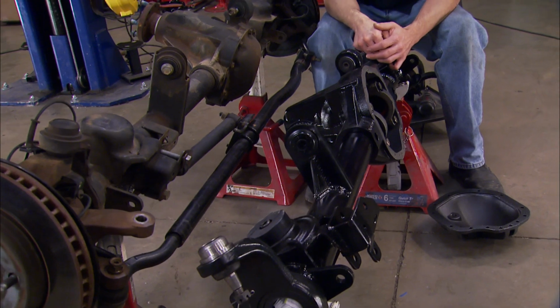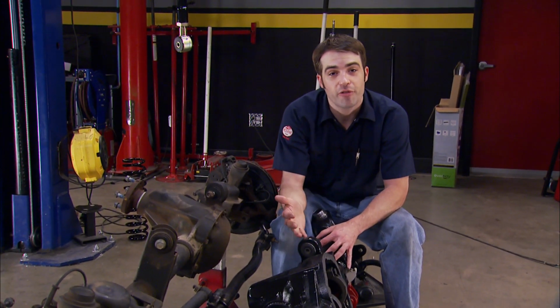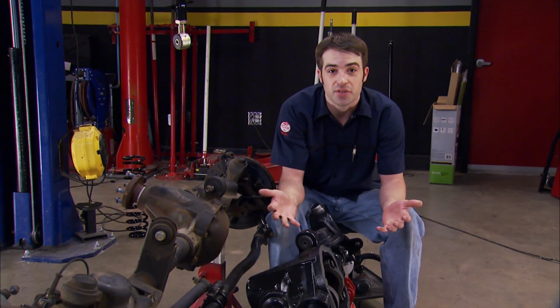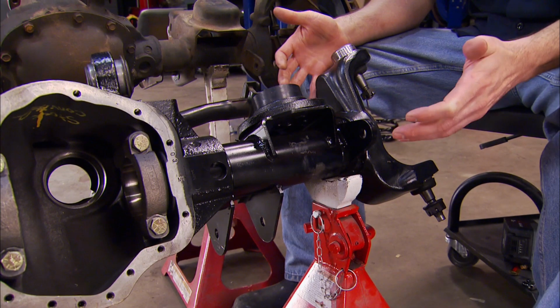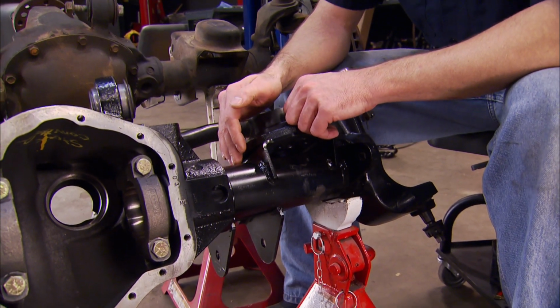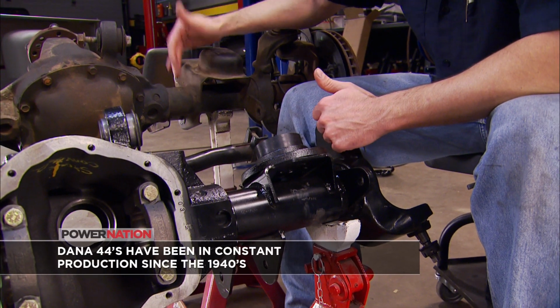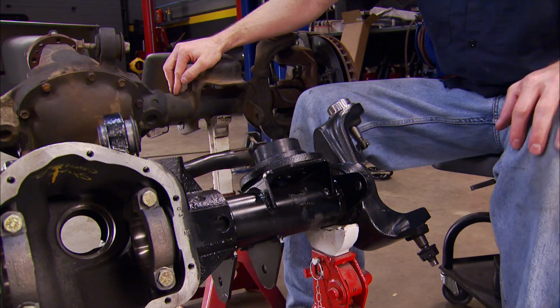So when Rusty brought up the suspension system, well, he also dragged up this bare Pro Rock 44 housing that he sells. And it addresses all the weaknesses found in the stock housing. This Dana 44 axle has 3-inch diameter, half-inch thick axle tubes, which is much stronger than the much smaller 1/4-inch thick axle tubes on the factory housing, which are known to bend.